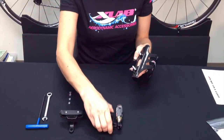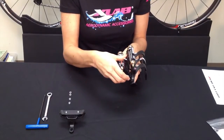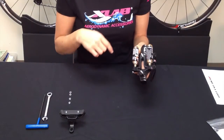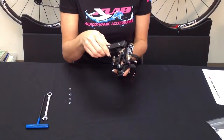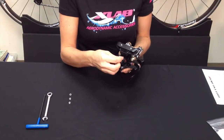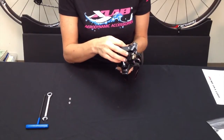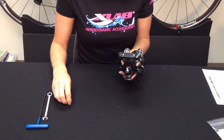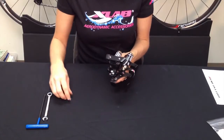Then you'll want to put your X-Strike CO2 kit on the back so that your CO2s are facing downward. Then add the mount right on the back, followed by your aluminum washers. Then loosely tighten your nylock nuts.